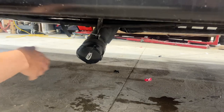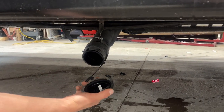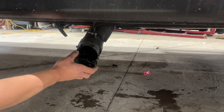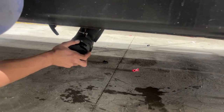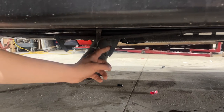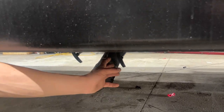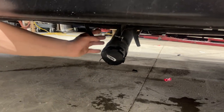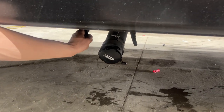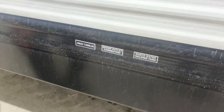Right by there we've got your sewer system. Press on that cap and pop it out — it's got the same ears on it that your hose is going to have, and it attaches the same way by pressing it in until it's locked on. On the left is a gray valve, on the right is the black. The black valve controls your black tank, which collects from your toilet — that'll be your dirtiest water so we dump that first. Once that's done you come to your gray. The gray tank is filled from your sinks as well as your shower — typically cleaner water, so we dump that last to help keep your sewer hose as clean as possible.